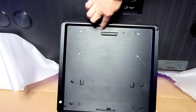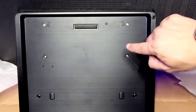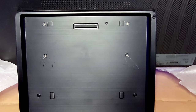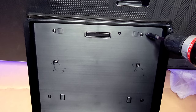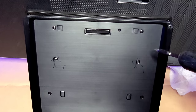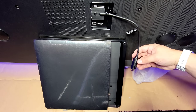Give it a good push and it's going to actually snap — this needs to be snapped into place before you put in the rest of the screws to secure it. Another thing to note: you're not looking for an empty hole to know you're lined up. What you're looking for is a sort of little brown-colored cloth — the screws are actually going to go into each one of those ports, four total. Couple of tips: first screw in the top two screws first or the bottom will not tighten. If they still won't tighten, go ahead and remove the rest of the packaging and let the TV sit on the stand and then it will flush out and tighten.